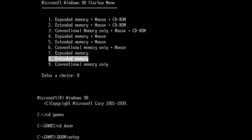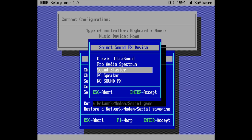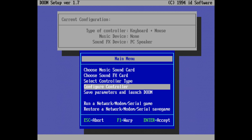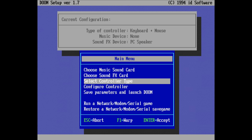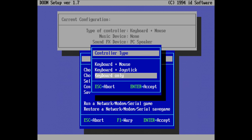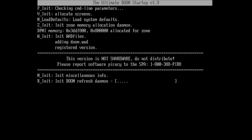For Windows 98 I would probably not recommend a micro drive — the performance is just too slow. But what about DOS? The capacities seem to be perfect, as a lot of older BIOSes on retro PCs have issues with large drives, so having hard drives of around 4 gigabytes seems ideal. But it didn't take long to notice something else going on with these micro drives.